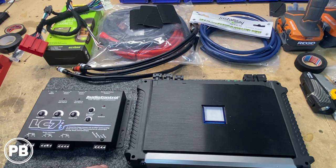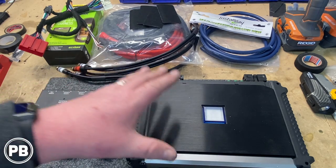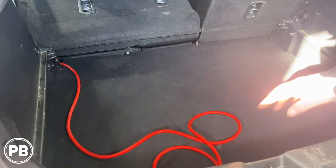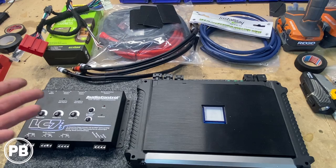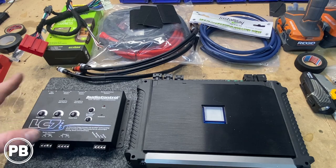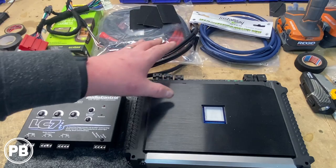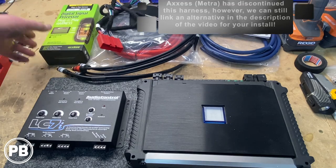We went ahead and got everything mounted — we cut a piece of MDF wood, got it all carpeted, and this will sit in the trunk area. There's a false floor in the trunk that sits above the spare tire, and within that cargo cavity this is a great location to add your amplifier, with the subwoofer sitting just right above it. To accommodate this in the vehicle, we need some various wiring bits. The best way to integrate this to the factory audio sound system is with a DSP T-harness.